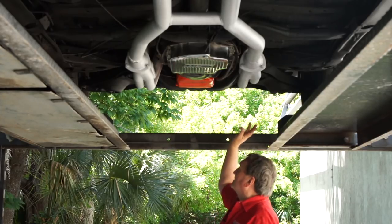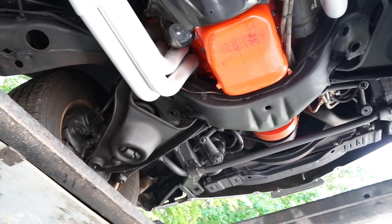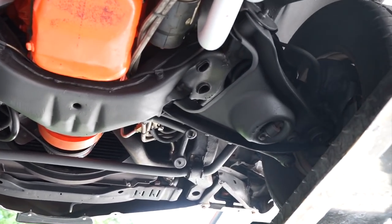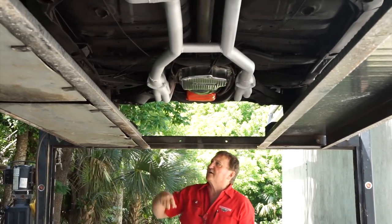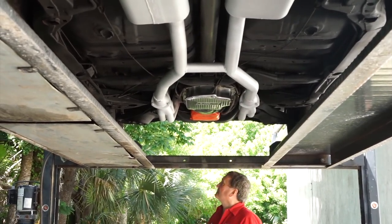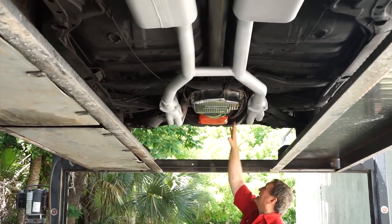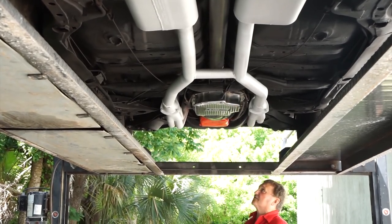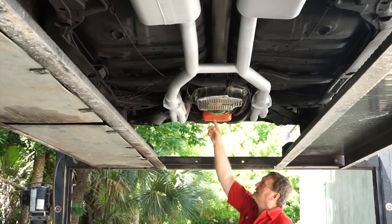Heavy duty F41 style sway bar in the front, long tube headers in the engine compartment. They look like they're going to be at least two inch, maybe 2 1/8 inch primary tubes on it, with a 3 1/2 inch collector. Full box frame that transitions onto a C-channel frame on the side of these Chevelles. No leaks on the power steering pump. You can see the engine has been out, completely refreshed and installed. The stock equipment starter on it is not a gear reduction starter. Also take note that there are no leaks on the engine or the bell housing area.